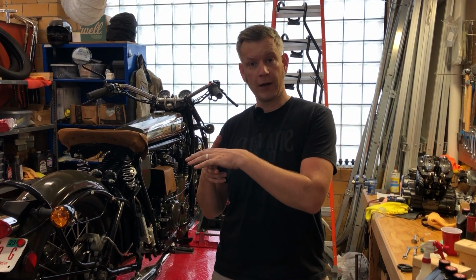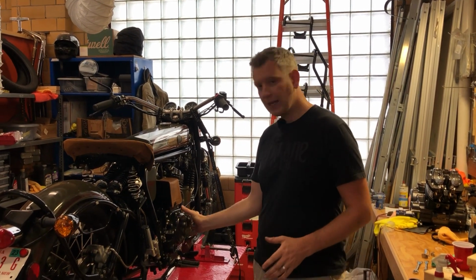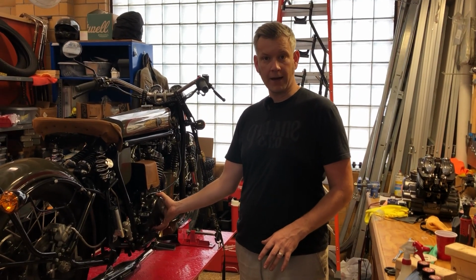The engine on the Halcyon 450 is what we call a dry sump engine, which means that it's a little different from the Halcyon or any of our Phoenix or Griffin 250s. The 250s use what's called a wet sump engine, and all that means is that on a wet sump engine, all the oil is contained in the engine case. So there's a sump at the bottom and all your oil is in there.